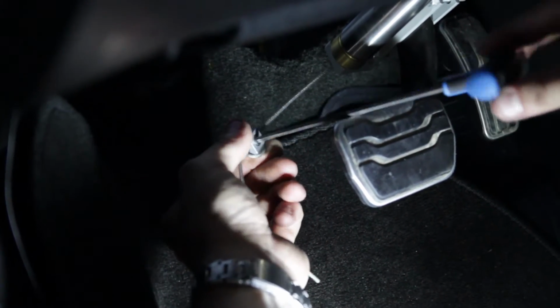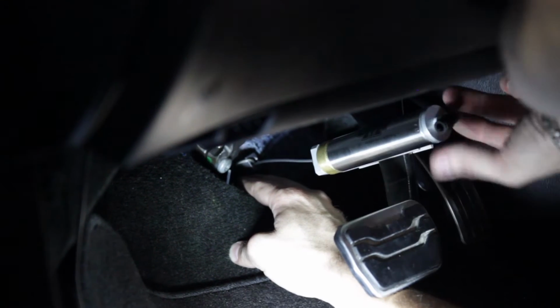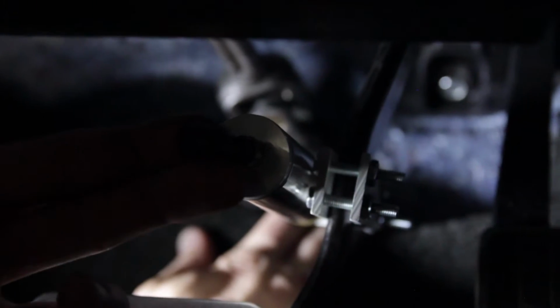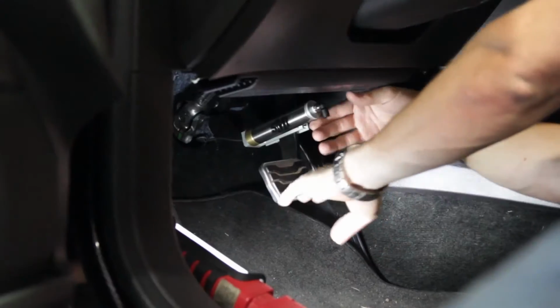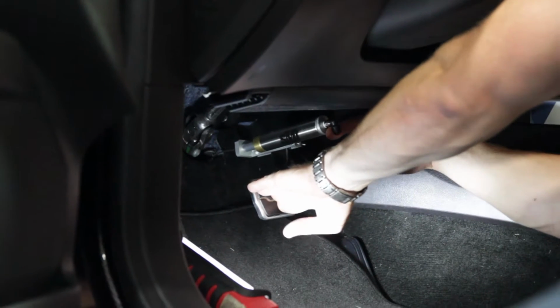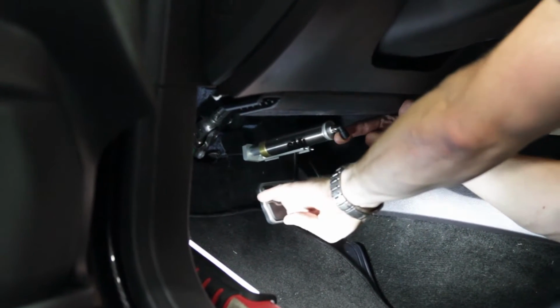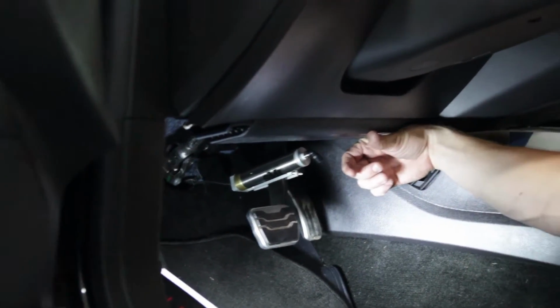Setting the cable tension is very important. You will want to first set the cable tension at the anchor. Then you can fine-tune the setting by moving the actuator front to back before tightening it down on the brake arm. Once everything's tightened up, we're going to move the brake pedal through its range of motion and make sure that the cylinder moves freely along the actuator.